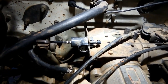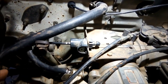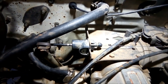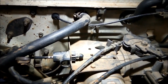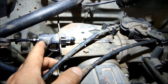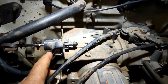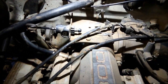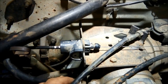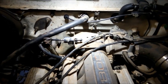The throttle cable is inside the transmission — there's like a little valve that it operates on, and it'll control your shift pattern, how quickly it changes through the gears, and even a little bit on the firmness. He just wants it changing normally, so ideally I like to have them at maximum pressure so the transmission's operating properly, but some people don't like it shifting like that, so you can just back it off a little bit until that little bump disappears. So I hope that makes sense, anyway, thank you for watching.